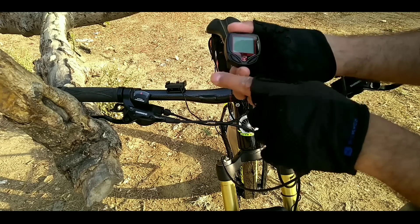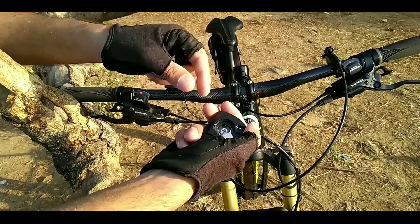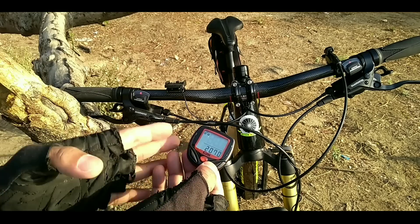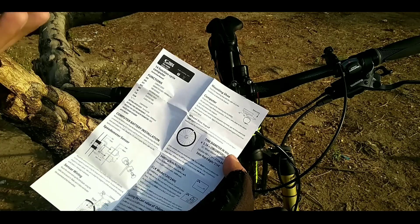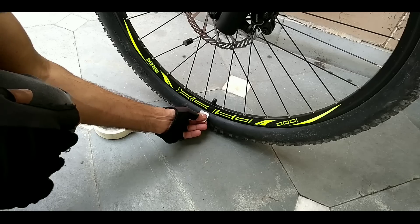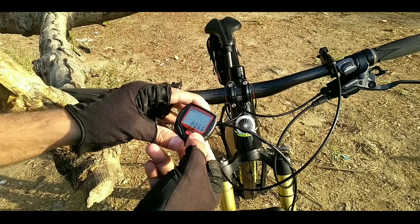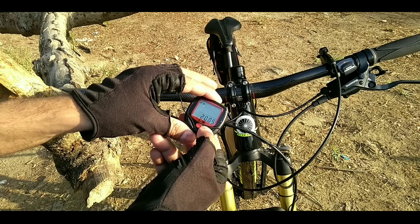You can see the head unit is closed at the back where the battery is. We open it up to insert the battery. Then we need to program the wheel circumference — the reading was 2 meters 15 centimeters, so we input that. The last digit is 5, the second is 1, and it's done.